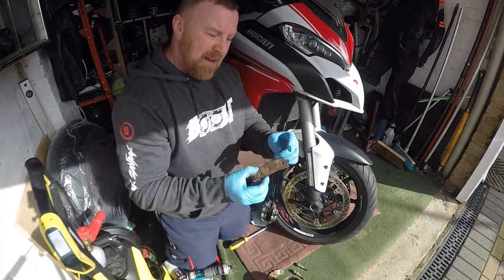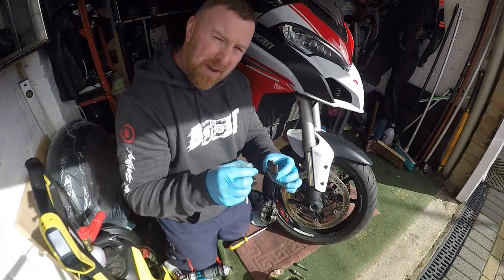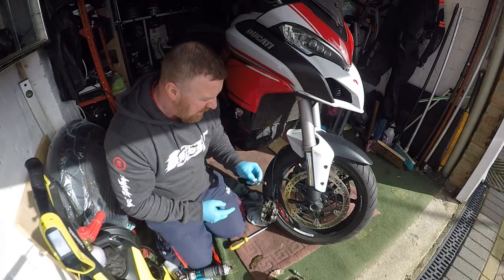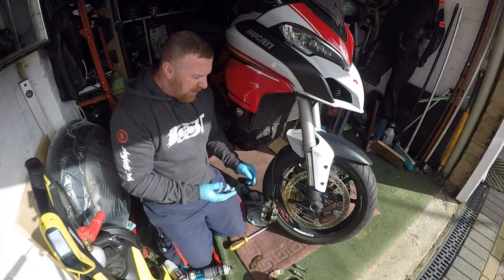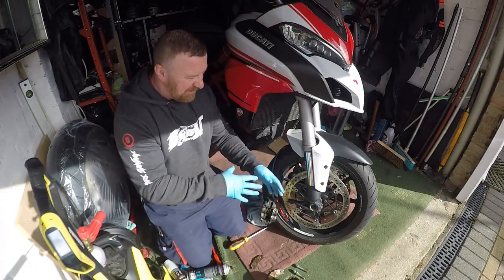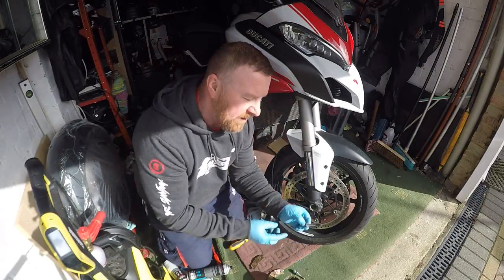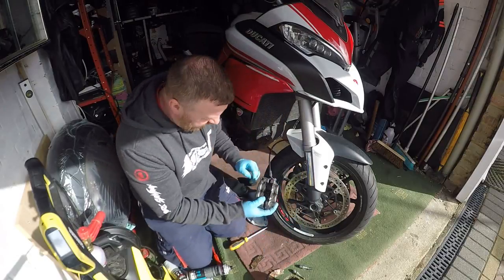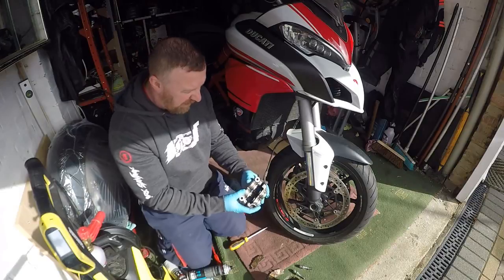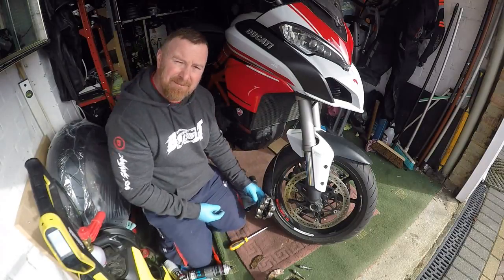For the sliding parts that hold the disc and go back and forward, a little bit of copper slip - it's not going to hurt having a little bit there. Don't get carried away and smother the whole thing - remember these are brakes. I've put a little bit on the bolts too, only because I know I'm keeping the bike longer and it makes them much easier to get back in and out. You're going to get water in here, it'll expand, retract, and get dirty - this will make them a lot easier to remove. Remember how they went back in - clean rag on the pads, if you've got a dirty rag when you finish you know you've done a good job. Then replicate this on the other side - nice simple 20-minute job.